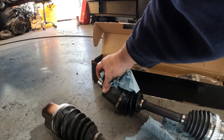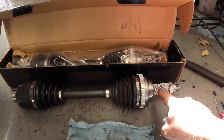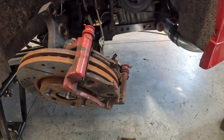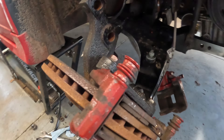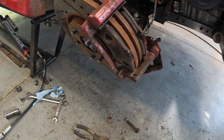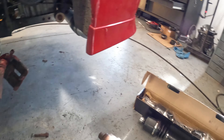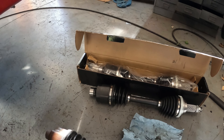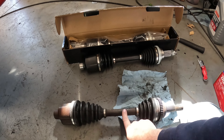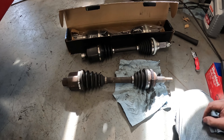What I'm going to do is coat the inside of the hub with anti-seize, fill them up, get some on the splines, and also cover the splines and threads when doing these axle installs. Everything's cleaned up. We are going to be looking into doing something with these brakes here soon — they were just usable last time but they look like they're down now, so we'll be getting new ones.